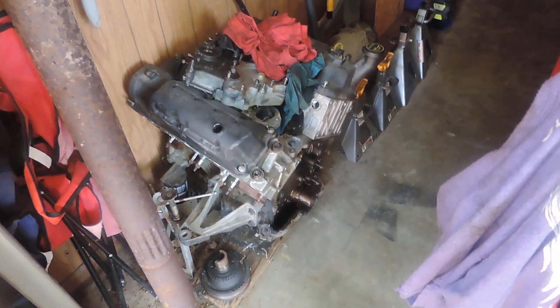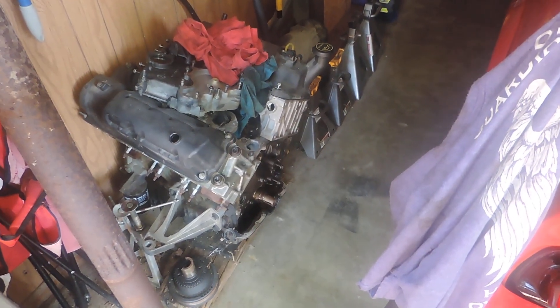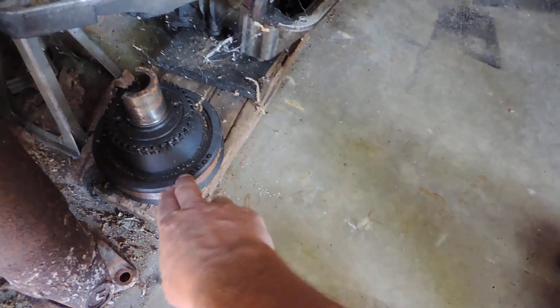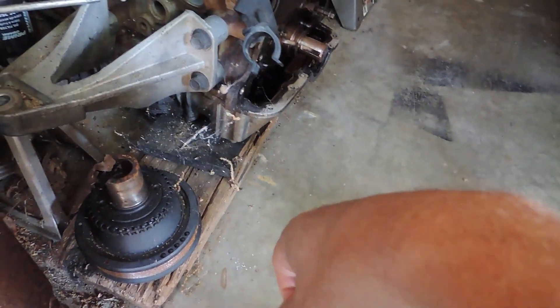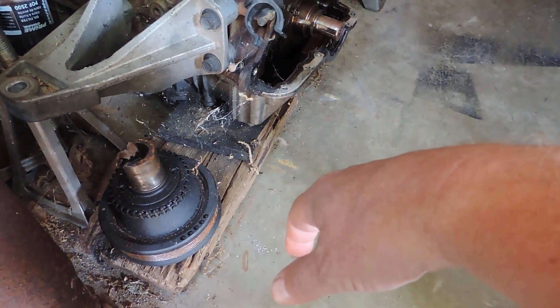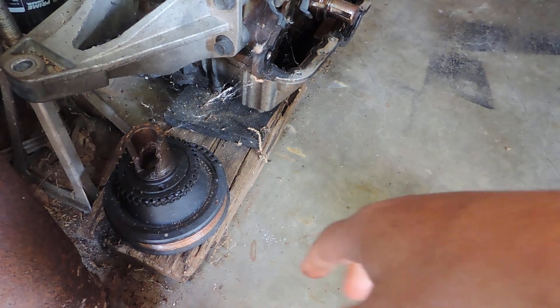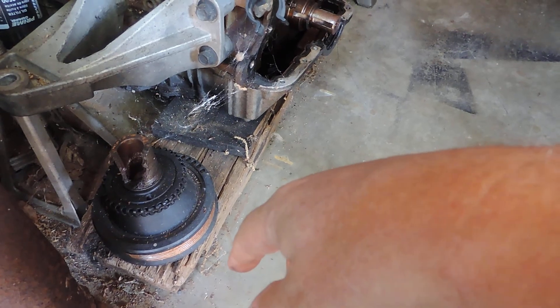Anyway, this motor's junk — boat anchor. What happened was, I've had this car a number of years. The original OEM harmonic balancer actually separated where — I guess it's vulcanized rubber — where they put the pulley onto the balancer, it separated. I replaced it with a parts store part, probably made overseas at a lower quality. As you can see, it failed. I don't know the root cause — it's just the tension of the belt over time fatigued the lower quality metal, or if it was improperly cast, but it failed.